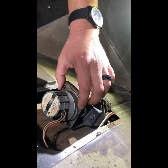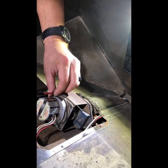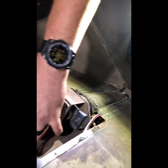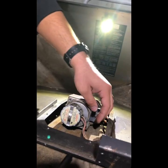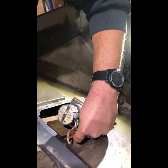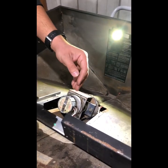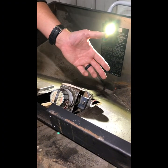The next step is to go for the four screws on the auger motor itself. This is where the extension comes in handy. Use a Phillips bit on the impact and tackle each corner of the auger motor. Hold on to those screws with your fingers when removing them, because if you don't, they fall way down underneath the hopper and you'll never find them again.